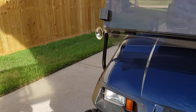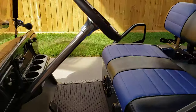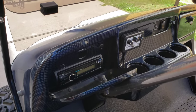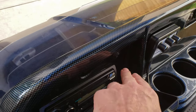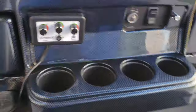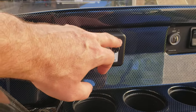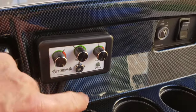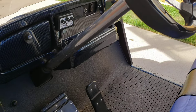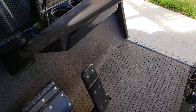There's some silly stuff on it like fuzzy dice and a full-time bicycle horn — that's just for laughs. Things I did manage to do: it has a marine stereo, so when you cut power you don't lose all your memory and settings. There's a power switch right there. I also put in a new motor controller for speed, with settings for regen on deceleration and acceleration. I keep it maxed out — this thing tops out at about 18-20 mph. With regen, the bottom half of the throttle is go and the top half is regen, so once you learn it you don't really need to use the brake much.